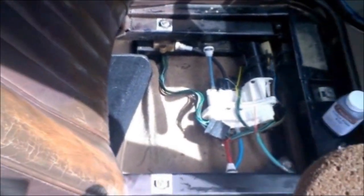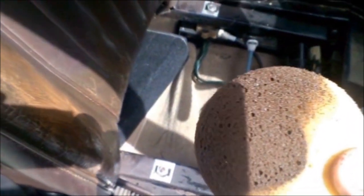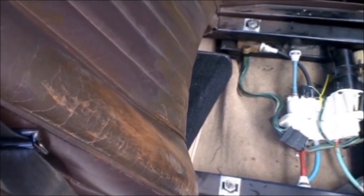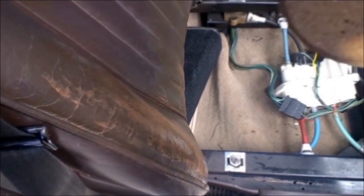Now this fortunately is water soluble, so I can just rinse this out, and as a matter of fact on the second coat it's good that the sponge is damp with water, because it spreads it more evenly. You might need say 2 or 3 coats of this colouring, and then let it dry thoroughly. After you've done that, you then put on your leather conditioner, whether it's Connolly Hide Food or some other proprietary brand, or even Dubbin's pretty good for this, afterwards.